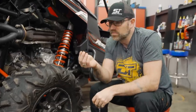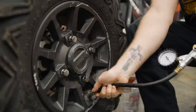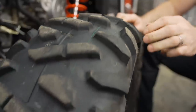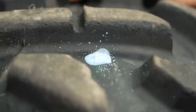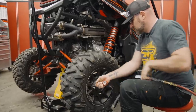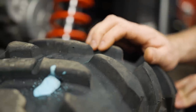Next, remove the hose, replace the valve, and put a few pounds of air pressure in the tire. It's important to rotate or drive on the tire slowly so the sealant can fully coat the inside of the tire and find the leak. If you have a sidewall puncture, you need to tip the tire on its side so the sealant can coat the area where the leak is located. After rotating the tire, you'll see the white Tireject sealant coming through the hole to the outside of the tire. Don't worry if it drips through the puncture a bit on the outside — this is completely normal and it's merely allowing the Tireject to collect enough of the fibrous material to plug the hole. Rotate the inflated tire a few times to make sure the inside is coated and sealed. You might also see bubbles coming out of the hole along with the solution sometimes — this is good because it means the air pressure is forcing more fiber into the hole.